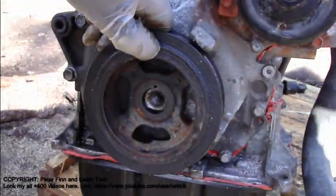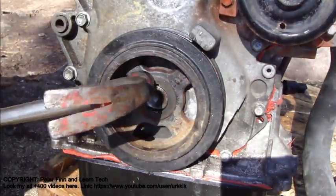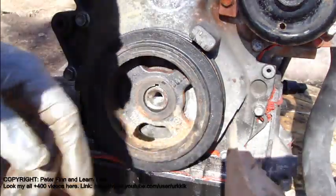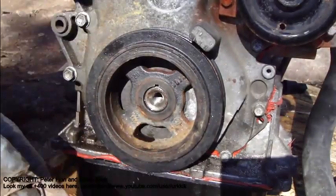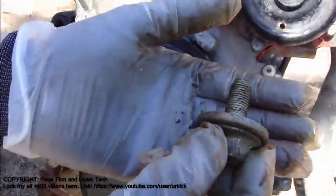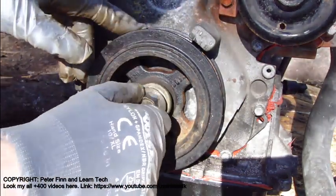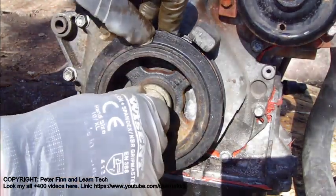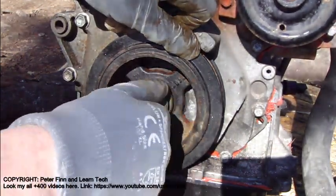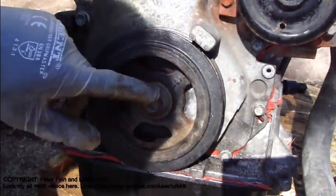And then I need to use my hammer, and I hammer that part to the end, so a little bit of hammering, and then I clean that again, and then we have an interesting thing. I clean this bolt, because this bolt is, I think, the thickest part in this engine. This bolt I will tighten soon, something like 140 or 150 newton meters of force, and this is a huge amount of force in that bolt.